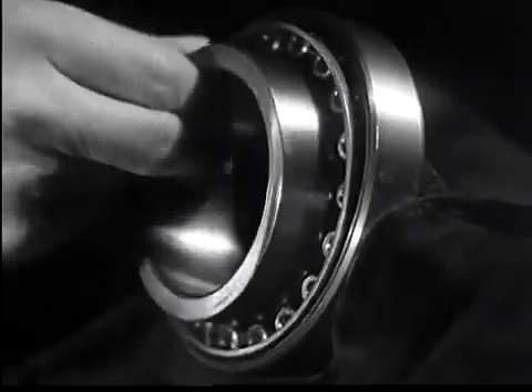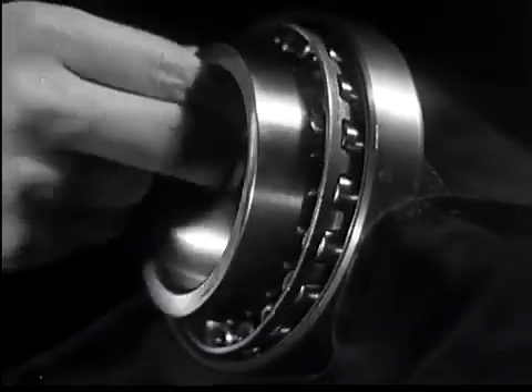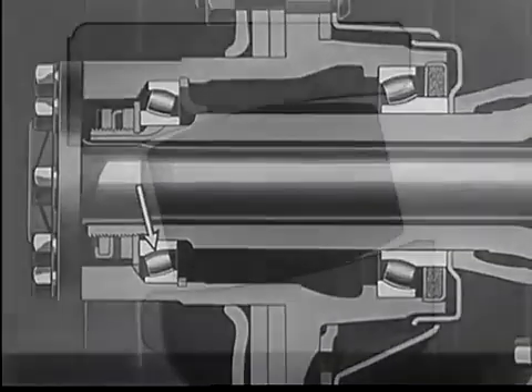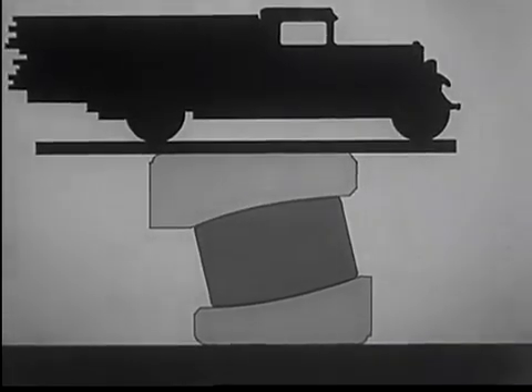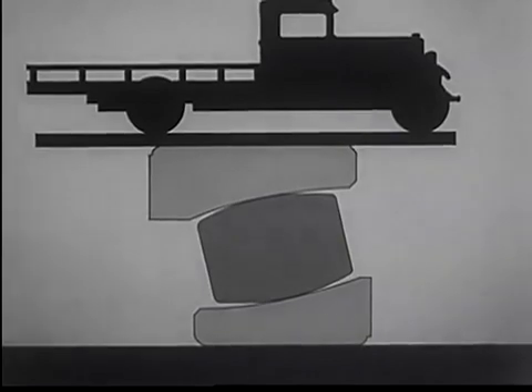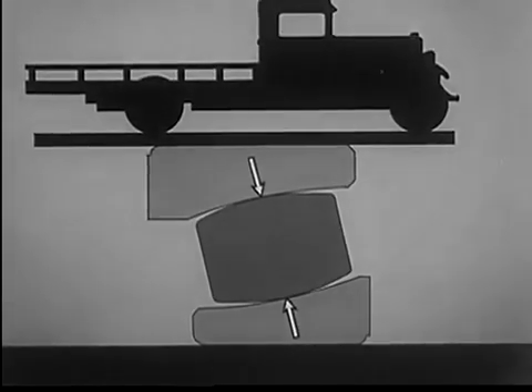One of the outstanding features of Chevrolet's new full-floating rear axle is the barrel-shaped roller bearings, which are entirely self-aligning. Because of the barrel shape of these rollers, they form only a small area of contact with the races under normal load conditions, reducing friction to a minimum and keeping the rollers in exact alignment. As the load is increased, each roller spreads into the bearing race providing support along the width of the bearing. When the load is decreased, again the area of contact is decreased so that the capacity of the bearing is always in proportion to the load.